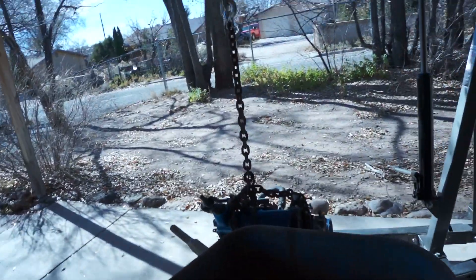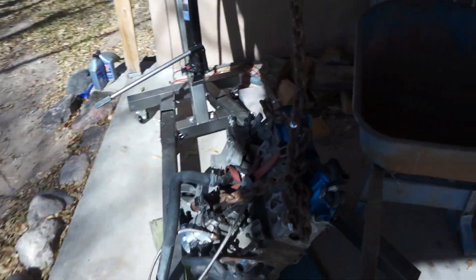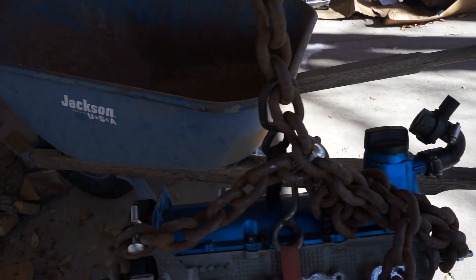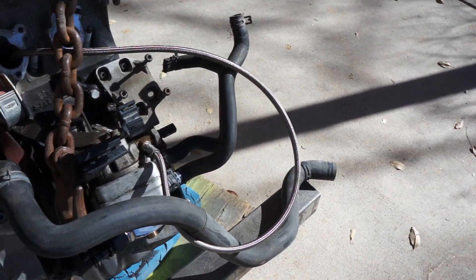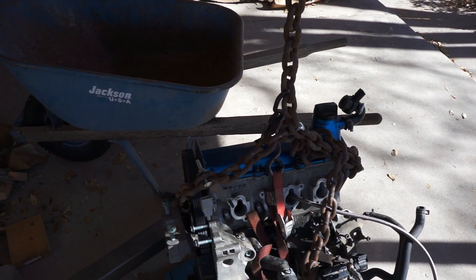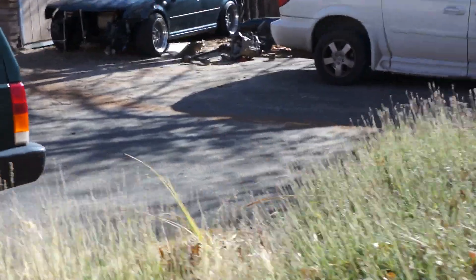So what is going on today? I got the engine out of the house, so we are chilling right here on the crane. It is just mounted in one and two mounting points for now, and then also the tie down around the bottom, so three mounting points basically. Today I'm gonna pull the axles off of the transmission that is sitting over there by the car, and then we're gonna work on putting the clutch, flywheel, and clutch on, and then putting the transmission on while it's on the engine stand.